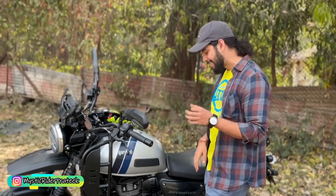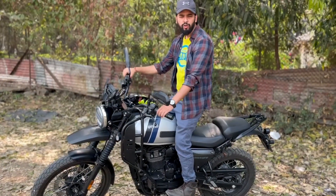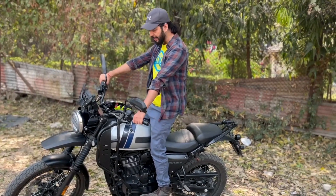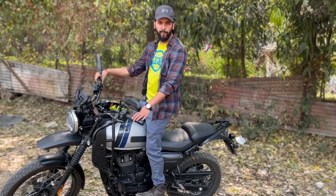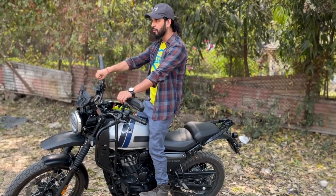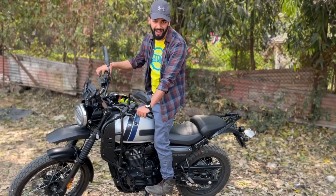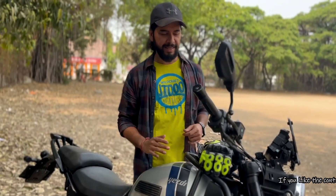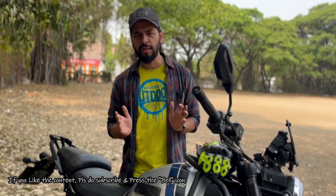In the off-road discussion there are two key things. First, the saddling position — you can sit on this bike very comfortably and stand on the off-road trails. I feel the handlebar is a little low for saddling, so I would install handlebar raisers to get a more comfortable stand-up riding position. Second, the 21-inch front wheel, which is now standard for the adventure segment. A larger front wheel means you go over small obstacles rather than into them. Spoke wheels, compared to alloy wheels, definitely offer an advantage in normal off-road riding.